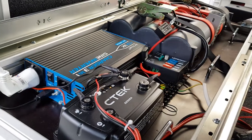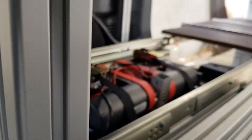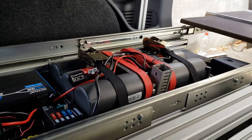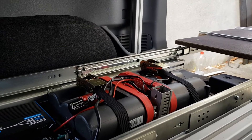We have different fuses for the accessories. The reason there are two batteries in here is that they're both six-volt and wired in series, giving us a 12-volt system. They're Optima Redtops.